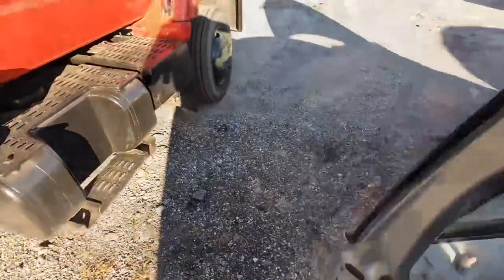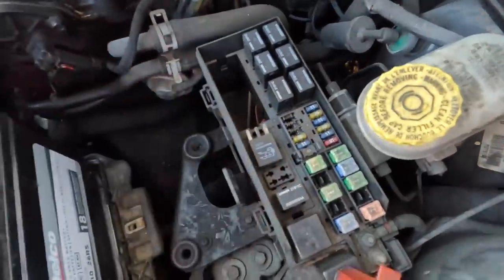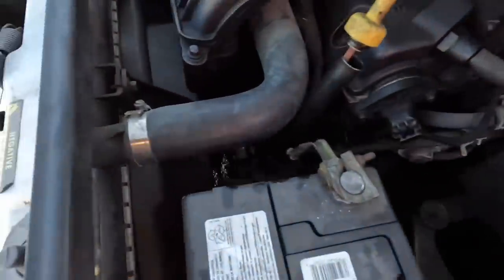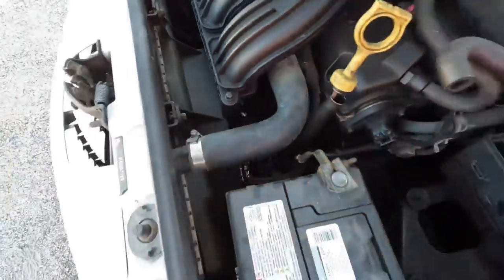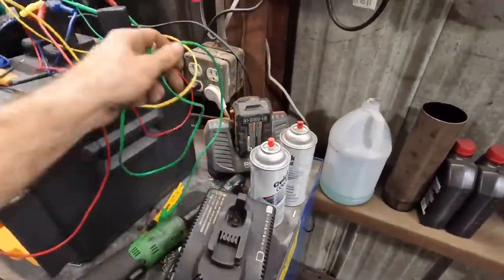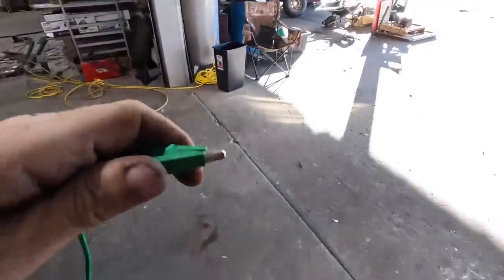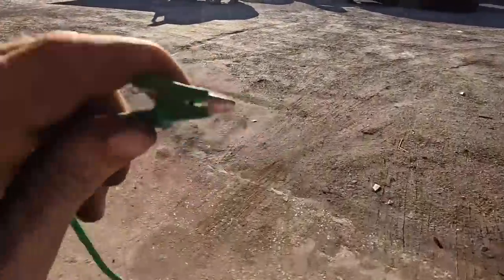I found the fuse box cover removed under the hood. There's a relay hanging out right here — and there's a starter relay. It's got a newish looking starter; someone's replaced this before. Let's probe that. I'll get a wire lead on it — we'll see if we're getting power down to the solenoid from the key. So far we have a no-crank condition. I'm going to fetch a wire lead and connect it to the terminal where the exciter wire is for the solenoid — the power sent from the key to close the solenoid and crank the starter.